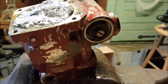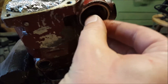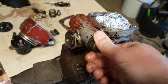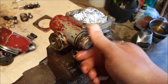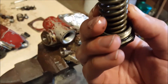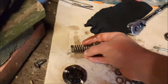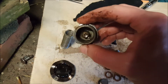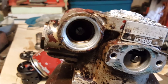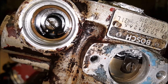This is the advance piston. I think it pretty much does the same job as advancing the spark on a gasoline engine — as the engine speeds up, you need the fuel to squirt a little bit earlier. Things were a little dirty in some places and you could definitely see signs of wear and rub on some pins and parts that moved. I polished up some of those things, and I'm just hoping that cleaning and attention on little items here and there will really solve the problem.